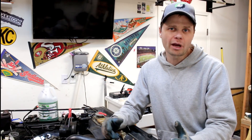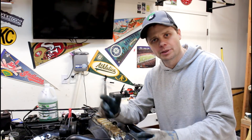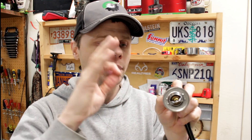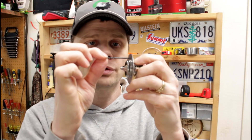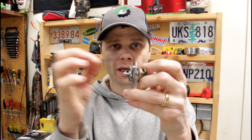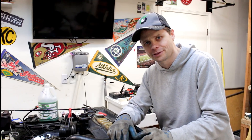Now if you're new to the channel, consider subscribing — I'd love to have you follow along as I rebuild this old YJ. And a simple little shop tip: if your thermostat has a little hole at the top, a little bleeder hole, that's for air to come out of the system. Make sure that little hole is at the very top when you install it. If it doesn't have a hole, you can just drill your own with a real small drill bit — drill a little hole right at the top. It's not going to interfere with the function of the thermostat at all, and it'll help allow that air to pass through. Thanks for watching and have a good day.